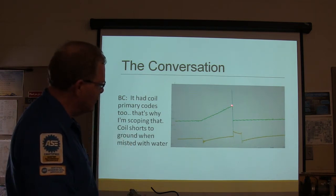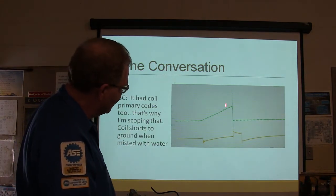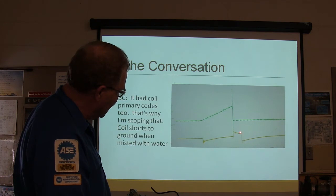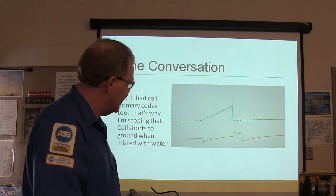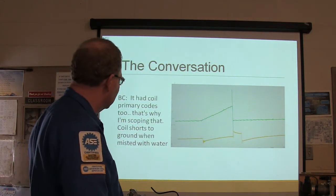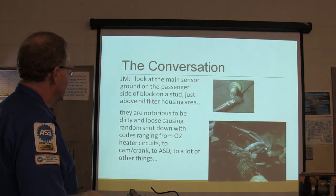See, when it initially jumps, it's kind of like that high hump at the beginning of the relative compression. When it initially jumps, and how long it burns is right here. And as it ramps up on the end, that's because it used up the fuel. When it used up the fuel, the resistance increases, and it jumps up, and then it snaps, and you've got a little rough leftover energy here that could have been used if you had more gas. That's the thing.